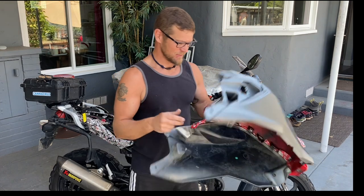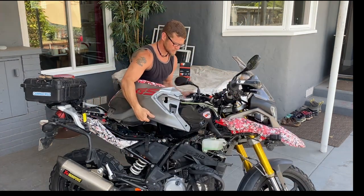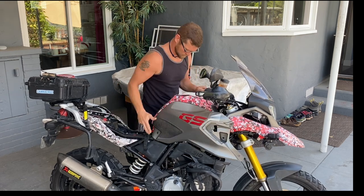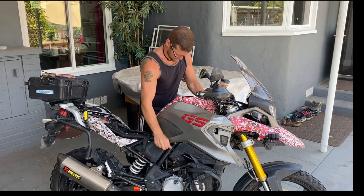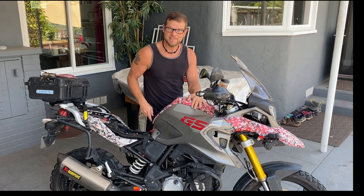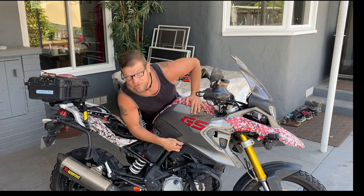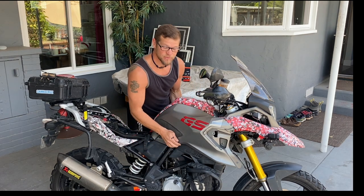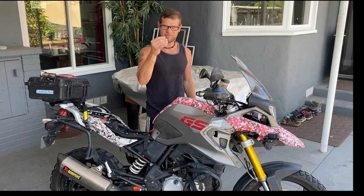So we're back to the shroud. Remember at the bottom there is a ridge that's going to go around your fuel filler. Once you have that settled in place and flushed on your fuel filler, make sure you didn't lose any clips on the side when wrenching around those clips on the side there. Then it's back to town with your five millimeter Allen key.